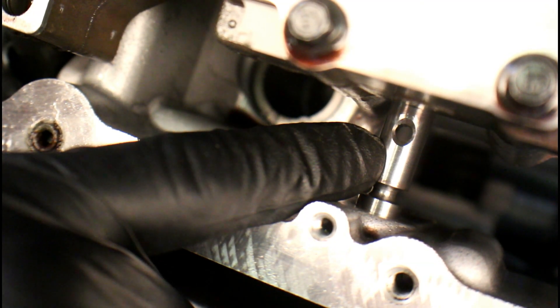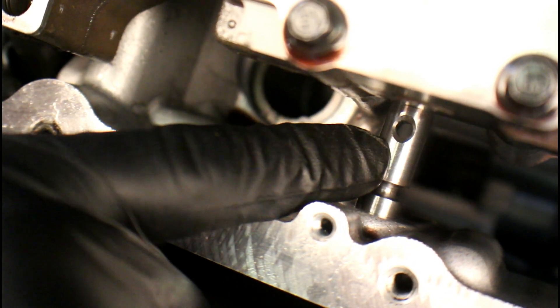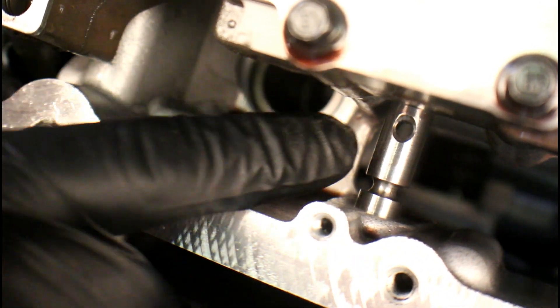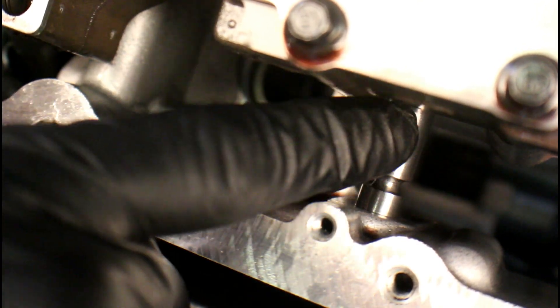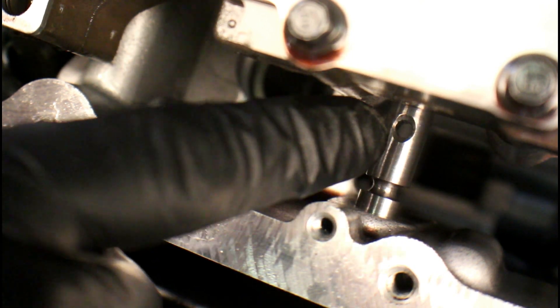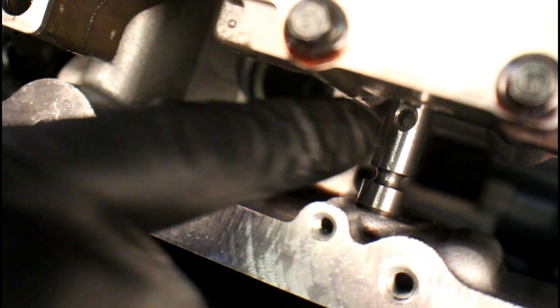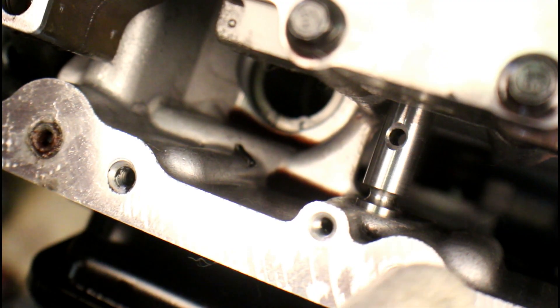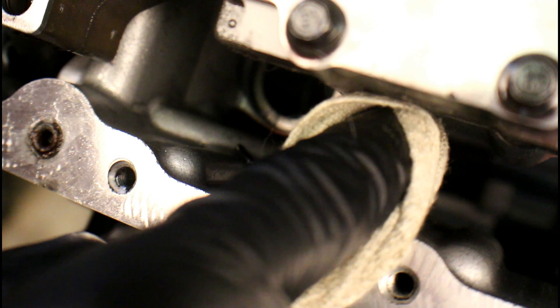When it comes to that selector shaft, keep in mind we're trying to line up a roll pin with this hole. The problem is the range sensor is going to be covering this up, so you're not going to be able to see it. What we're going to do is paint a line down this shaft so that when we put the range sensor up we know about where to line the roll pin with — that way it'll be a lot easier to install. Go ahead and clean this surface off. Grab your rag and wipe off that shaft so we don't have any excess transmission fluid or anything that will prevent the paint from sticking.